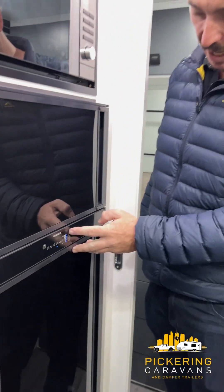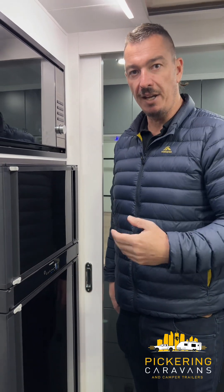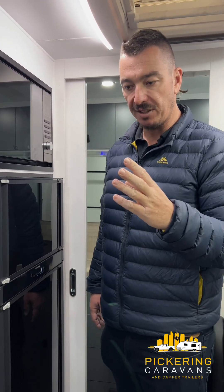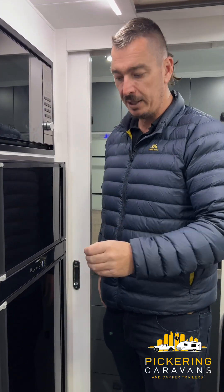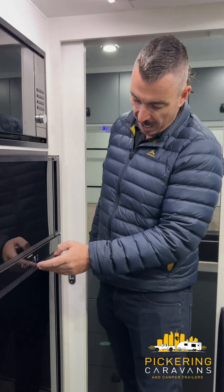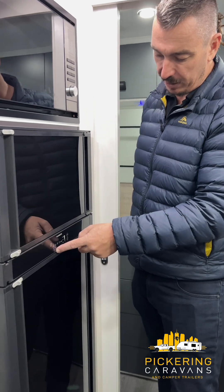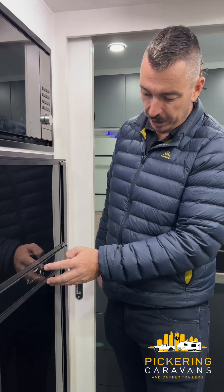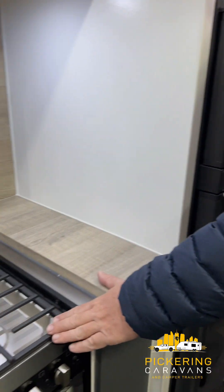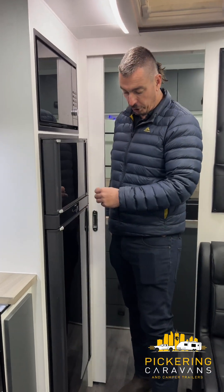One of the most common questions on this particular fridge is: when people have been free camping and it has been running on gas, then you pack up, get the car going, and travel to your next destination — what the fridge will do sometimes is burn the residual gas out in that line, which means when you go to restart it on gas you may hear a beep and it'll be flashing on gas. The way to clear that error code is to light your gas stove to draw some gas down through that gas line, turn it off, then turn your fridge on and off again, and it should clear that error code and be running on gas again.